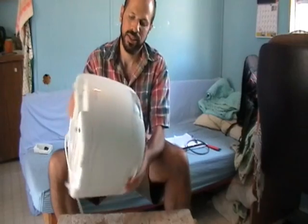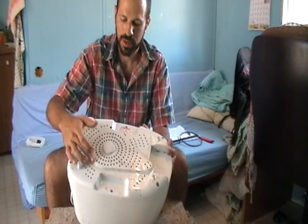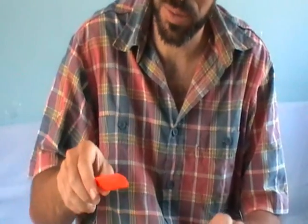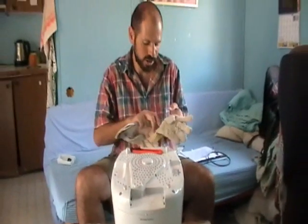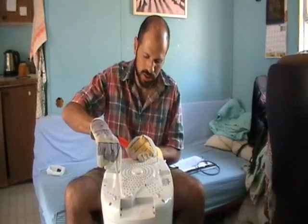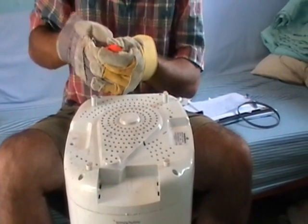The second way is by taking out this piece of plastic from the bottom — you actually don't need it after you fix the belt, so just leave the machine open on your kitchen counter, no problem. Make sure the lid is closed carefully. I open this plastic piece using a utility knife or exacto knife. Since it's a hard piece of plastic it's a bit dangerous, so I highly recommend using gloves. I start on the edge that's farther from the cable, since it's safer.